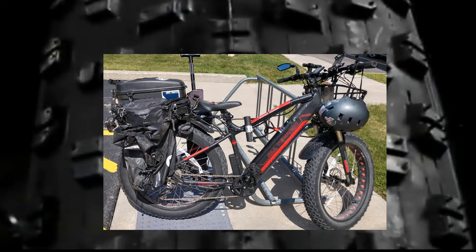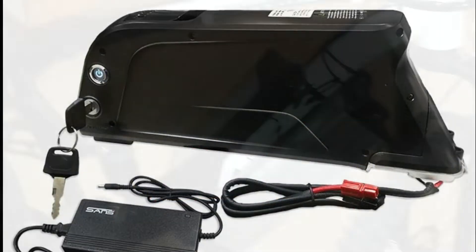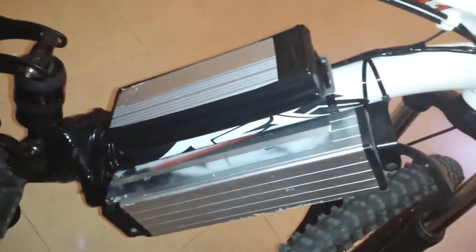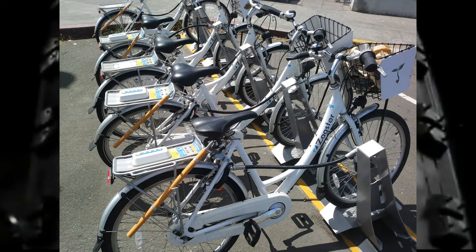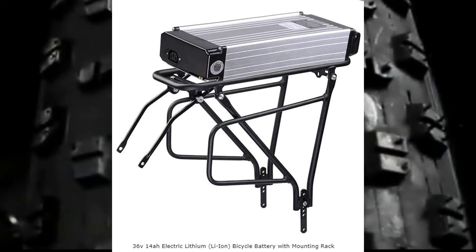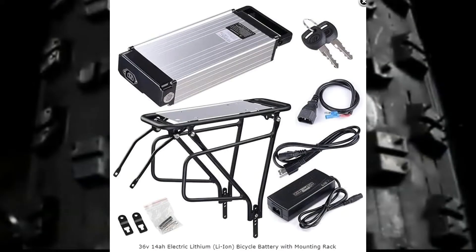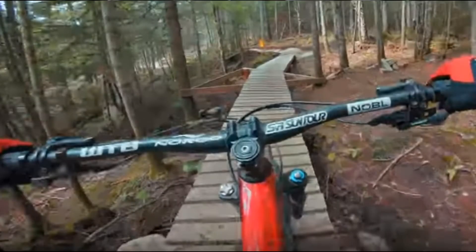Automotive connectors are all approved connection devices you can use. Find a good place to mount the battery. Locations include mounted against the front post, mounted on the middle post, hiding under a rear wheel package rack, or in a sidecar configuration for more batteries. The batteries are well encased and weatherproof, so be sure to dress all wiring to prevent moisture and insulation cracks or breaks that could expose power-bearing wires.